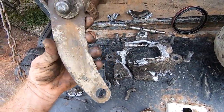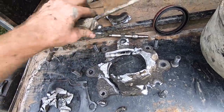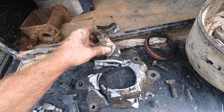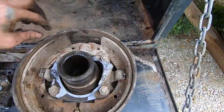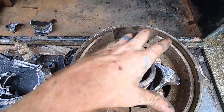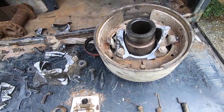The actual shaft itself is bent. I may be able to reuse this shift fork for the parking brake. This little ball here would have been mounted right in there, so it would have basically just pinched like that to engage and disengage the parking brake. This outer rim here is a drum and these are shoes — here and here. When you set the parking brake it pushes these out against the inside of the drum, braking the truck so it can't move.